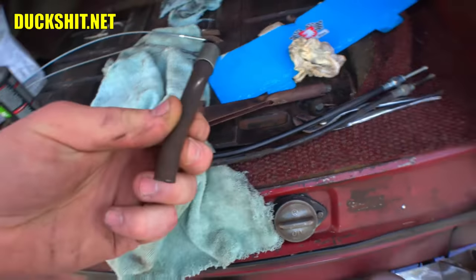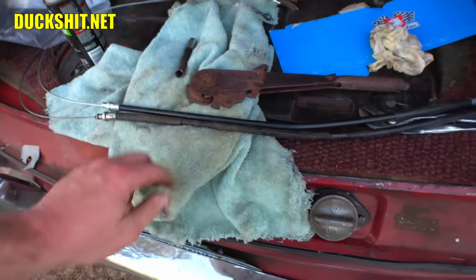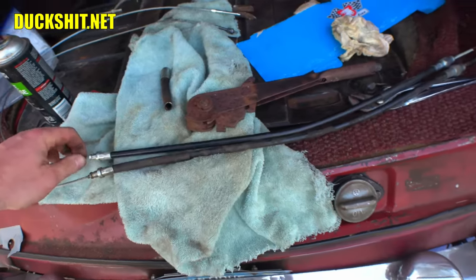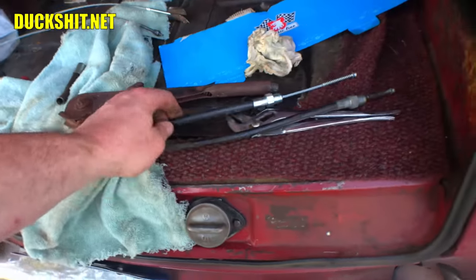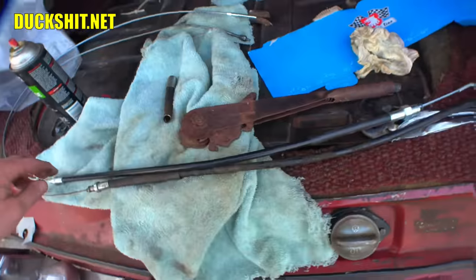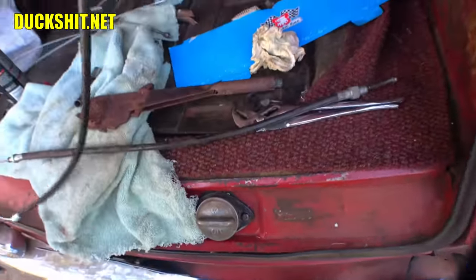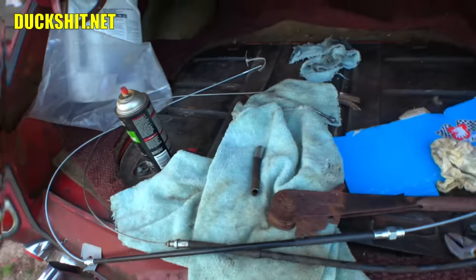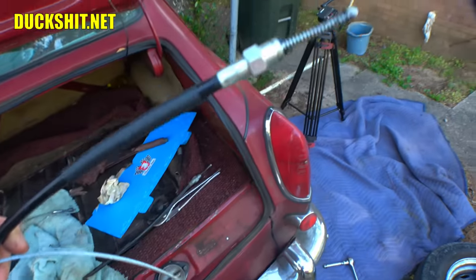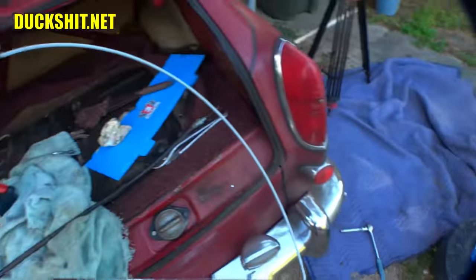And here's my little piece of pipe. I'll slide that over so it goes on the end there. But first we've got to get this cable greased up. I'm going to grease it as I put it in, but part of the cable — the lower half — we do need to grease first because you won't be able to get to it later. So we'll slide this up, expose the bottom, and then little by little slide it up to the end and push it in the chassis and grease up the other end.